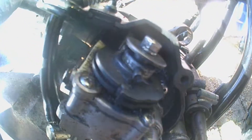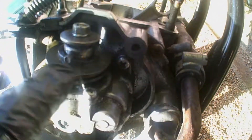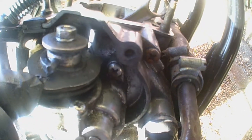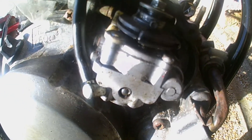Need to put this back in the right place. The throttle cable comes in there and the cable wraps around the back. You can move this by hand and follow the cable round the back, put it in there, and it all slips into place when you activate the throttle. It goes like that — it's a bit stiff because everything is all bound up together.